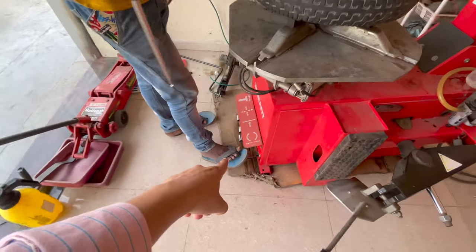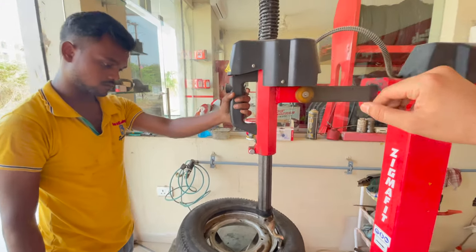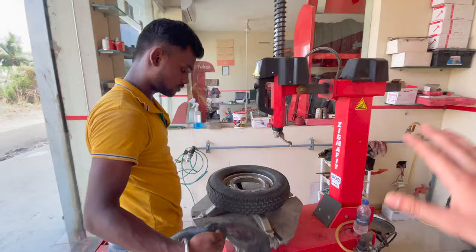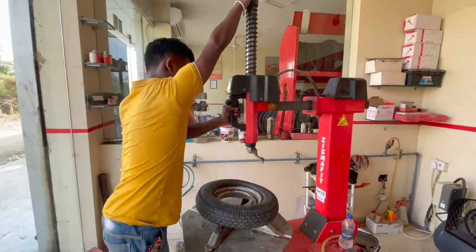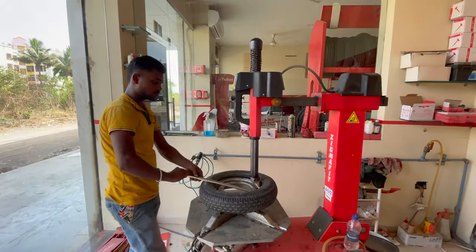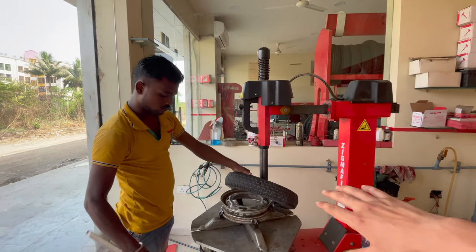The fourth step is to press it and the upper part is now free. To handle a tube tear, first you have to open it again — this is free. You have to free the tire and remove the tube. Now the tube is removed. You will see the same procedure again, but this time you will do the tube from the bottom part. Do it from there and your tire is free.